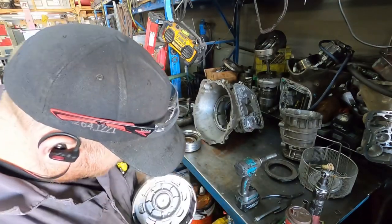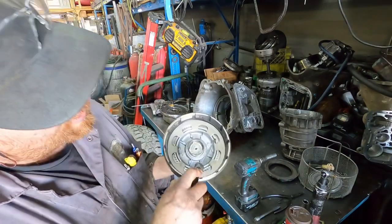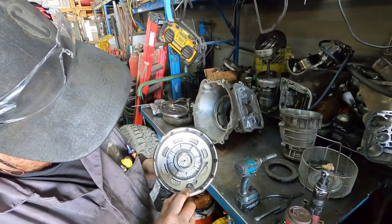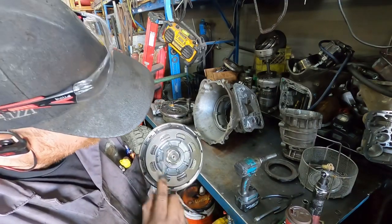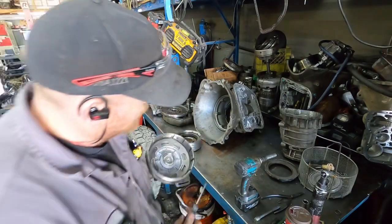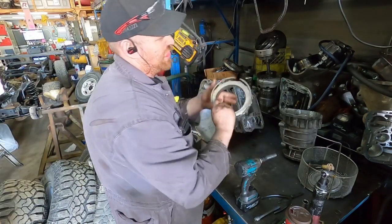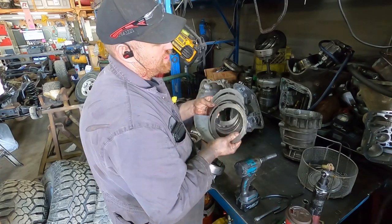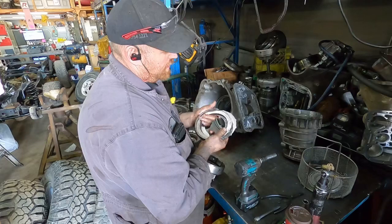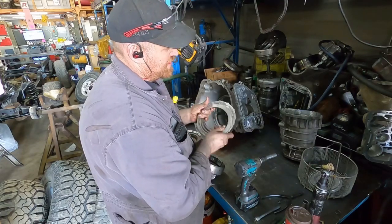And if you take that out, so this right here, this plunger or piston shoves up on this. Like I said, I'm not trying to fool you guys, so take this with a grain of salt. But the piston shoves up on this, which is what applies this clutch anytime you're going forwards. The only time this is disengaged is when you're sitting, so it's the only time this isn't engaged.